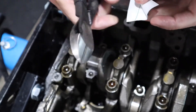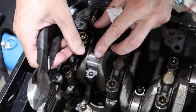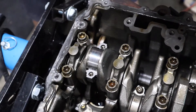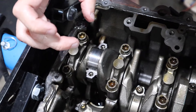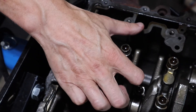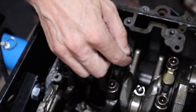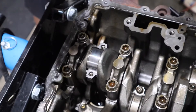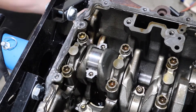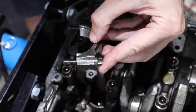Opening the package ever so slightly, we cut ourselves a tiny piece of plastigauge and push it into place right there. One important thing about plastigauge: you don't want the weight of anything affecting the measurement. For example, if this engine was upright and you wanted to plastigauge a main bearing, you'd never put the plastigauge on the bottom side, because the weight of the crankshaft would be supported by that tiny piece and squish it more than the real reading. This connecting rod has no tension or weight pulling down, so we should get an accurate reading. I will put a tiny bit of oil on the threads so the torque reading is accurate.